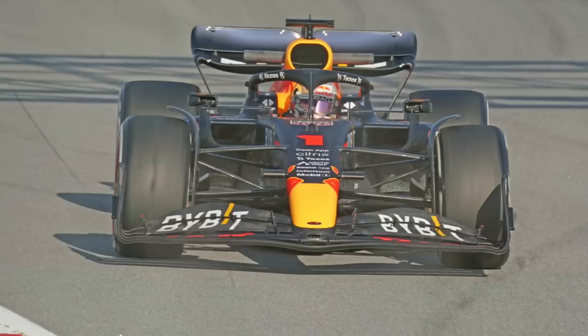I won't spend too much time on the front wing but some general notes: it's got that detached first element similar to what the majority of the grid have gone for. The top edges of the end plates are pretty outwashing — if you look at where this leading edge goes down here versus where we've got the trailing edge, we've got a fairly outwashing end plate on both sides of the front wing. And then below that the dive plane is a pretty conventional setup as well.